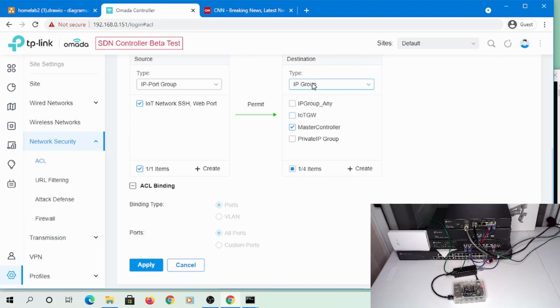If I would like to have it connect to anything in the family network, I just do that, and that tells me the whole IoT network is accessible by the family network, any device on the family network. So that will also work. Based on your use case scenarios, however you want it, maybe not the family, maybe you have another admin VLAN where you can manage these guest networks, that will also work. If you would like to manage it to the guest network or to the LAN networks, that should be okay as well. Okay, so what else do I need to cover here?